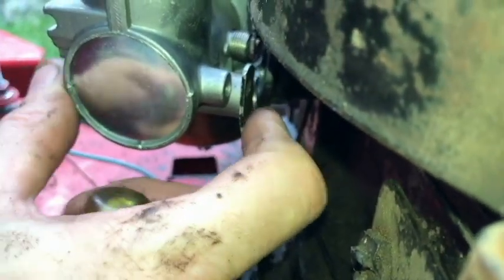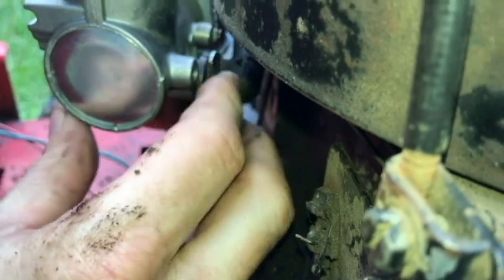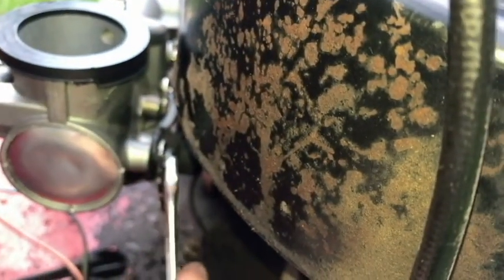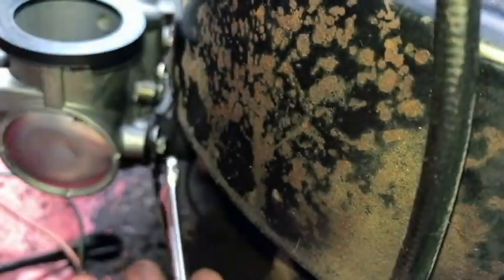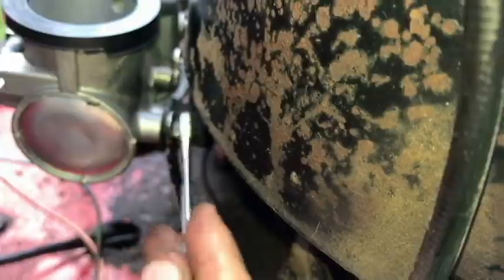Yeah, I left the old brace on, so I need to find the... see, I can put the rubber boot on from back here, actually. So there we go. We're on there. So I need to find that bolt and put it in the carburetor. Using the new screw from the new carburetor. This was the screw that came off the brace bolt. So I'm just using it here. Bolt's now tightened down. Got the gas line on here.